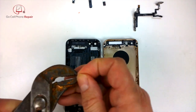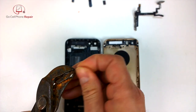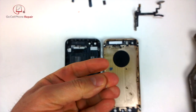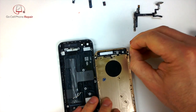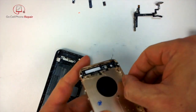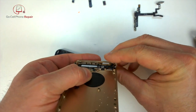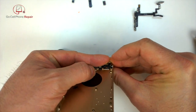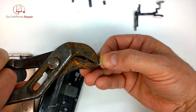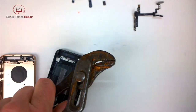You can see I just took some really beat up looking channel locks there to hold on to this. Didn't have my pliers on hand either. So now we have a suitable replacement for the pin. Just drop it into this hole, and that's what's going to be holding. Oh, I'm still measuring it here. So I found out at this point exactly how much length I needed and just bent it to mark where we want it to snap off. Hold that back in place and bend it a few times, and there you go.